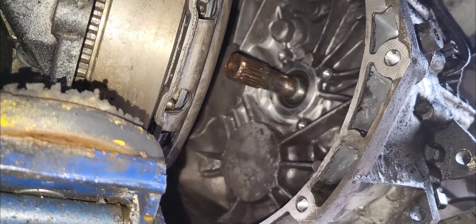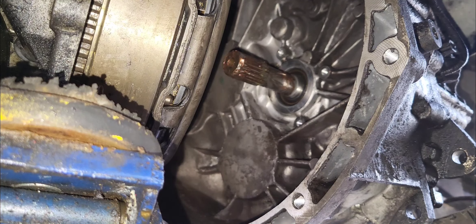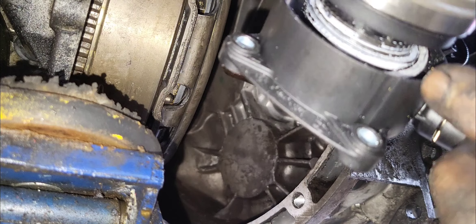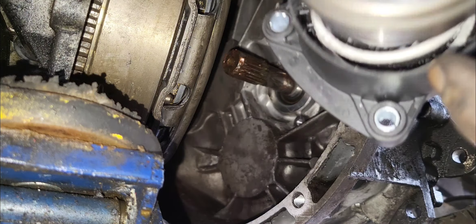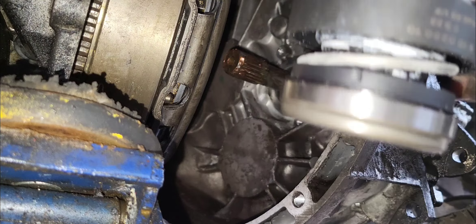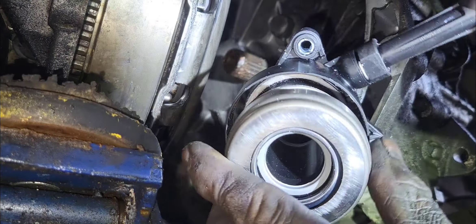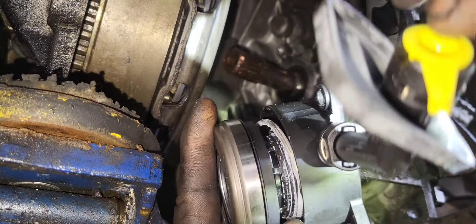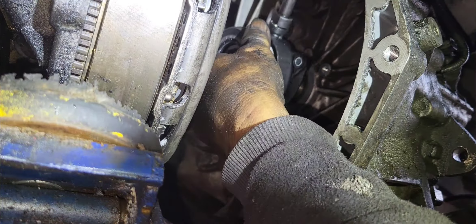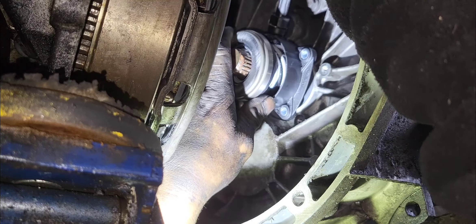The hydraulic release bearing has 3 bolts, 8mm. We also put rubberized grease in here. This looks new but seems old — it might be white grease or whatever. Anyway, the 8mm bolt is here. We'll keep it covered to avoid dirt. The 6mm clearance is set, and we won't tighten the bolt all the way up yet — just position it up top first.